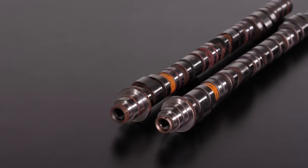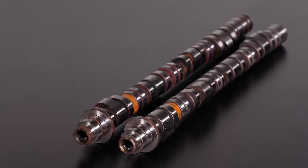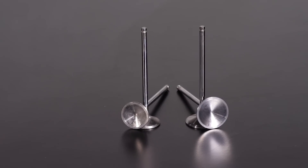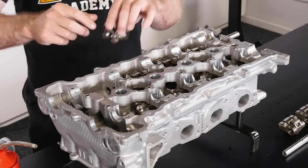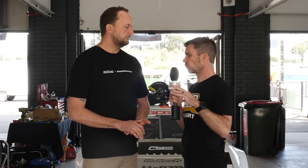Even on engines less prone to that, you are reducing engine life. By the time you have a sequential gearbox in a car, odds are it's a highly strung, high-powered engine with huge cylinder pressures, custom camshafts, and huge valve springs — so whatever you can do to stop that bouncing on the camshaft, the better. With an ignition-only cut, we're stopping the spark but still have cylinders full of fuel and air; that passes through unburned and ignites in the exhaust manifold, creating a pressure spike that can pop the exhaust valve back off the seat. You lose control of the camshaft and all sorts of ugly stuff happens. I prefer either a fuel-only cut or fuel and spark — it's by far the easiest on the engine.